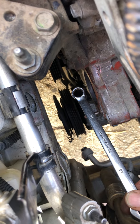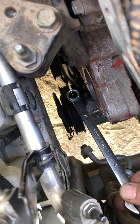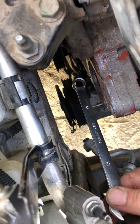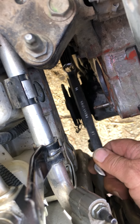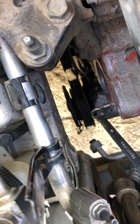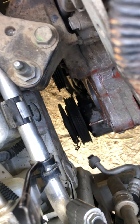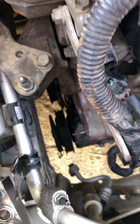Make sure your gasket is on correctly. I put mine on wrong the first time — I'd squeezed it in and if I'd gotten it in it would have been okay, but trying to get it back out destroyed the gasket. Be very careful, make sure it lines up, and use the alignment pins to set it up properly before you slide the new water pump in.